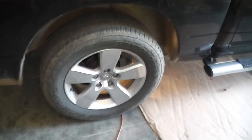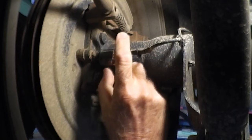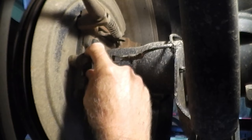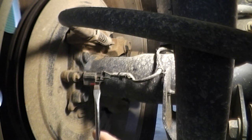This is the rear tire of my truck, and that's the rear end right there. We need to go in front of the rear tires. Here is the ABS speed sensor — you just disconnect this plug here, and this little screw here you just unscrew. This whole sensor slides out, and we'll put the new one in, plug it back in, tighten it up, and do that to both sides.